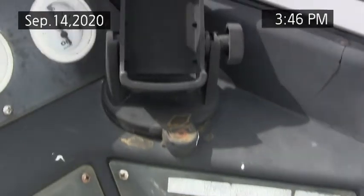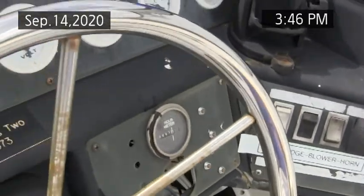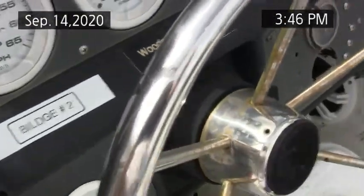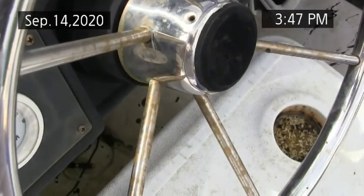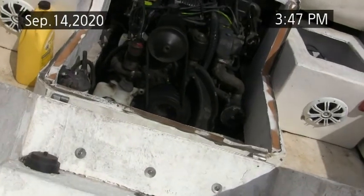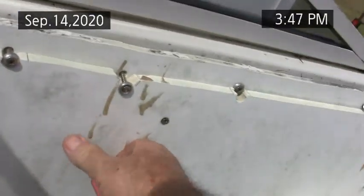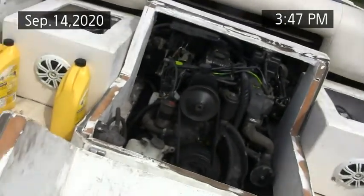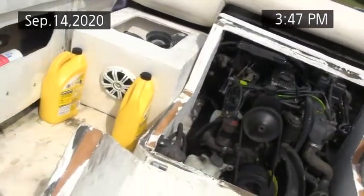We got like, I don't know, 40 PSI, 38 PSI oil pressure, half a tank of gas. Go back to the idle. That's around 600, 650. Stern drives don't like it too high in RPM. Went into reverse like butter. I put it in and out of gear to stir up the oil in the stern drive.